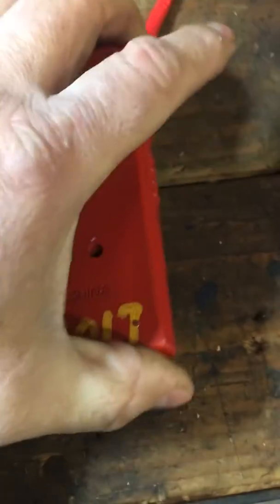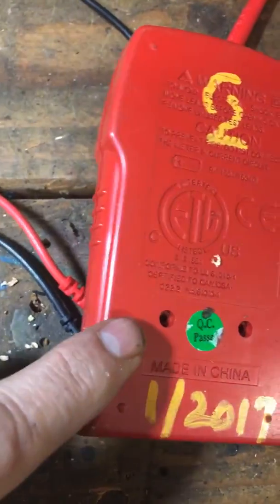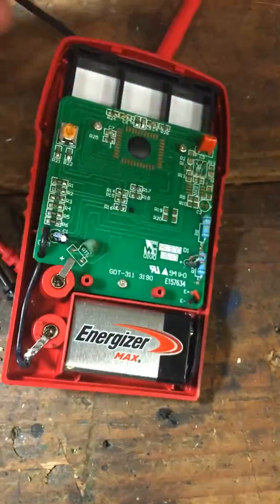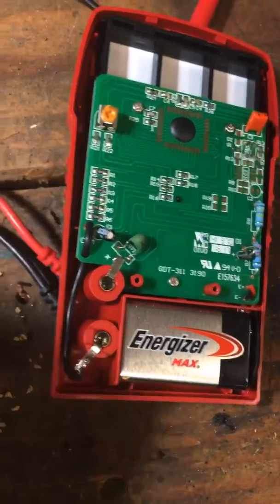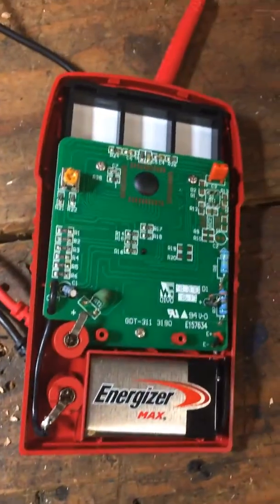Well it's really simple. Just turn it over. There's two screw holes there — Phillips heads. Take them out. You can see I've already removed them and this pops right off. Just pry it up from the back. And there's the 9 volt battery. The tabs are on the top as you can see, so you'll pry it up from the bottom — really easy.